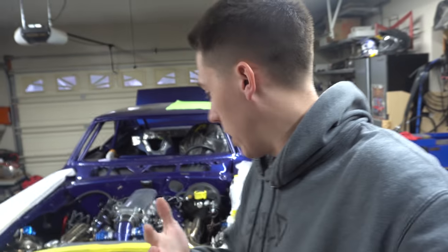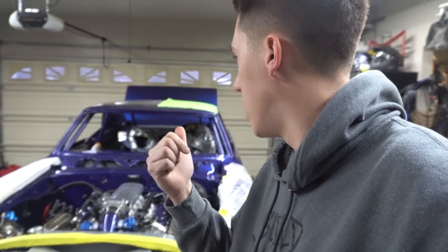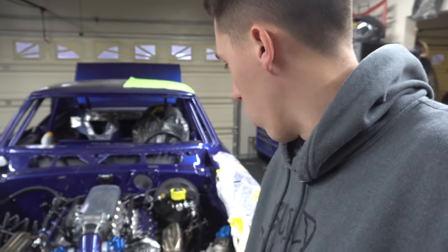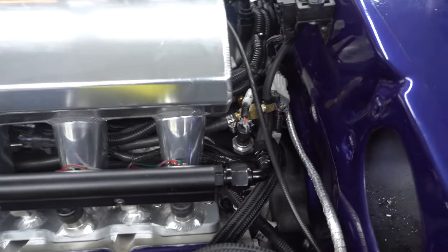That's what happened as we went ahead and started it. And then later on, we decided we were going to go ahead and put a manual oil pressure gauge in it. So we're only getting like 20 pounds at warm, as you guys can see in the video, of oil pressure. When we added this manual gauge, we're getting 40. So we're not too sure if it has to do with some of the remote mount and the feed with the cooler or what. We're going to swap it out and probably try another Corvette style sensor.